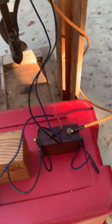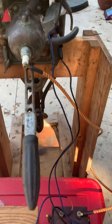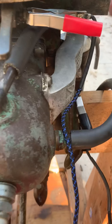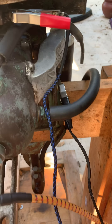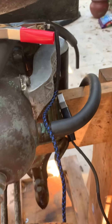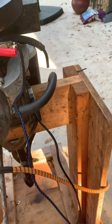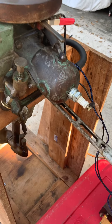I've got it hooked up to a buzz coil and running a 6-volt battery through the buzz coil and up to the engine. The negative side of the buzz coil goes in through the set of points on the timer right here, and then battery ground goes back to the engine frame. The mixture is about 16 to 1 or 20 to 1, anywhere through there.